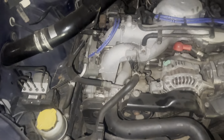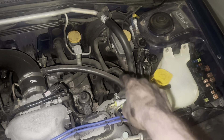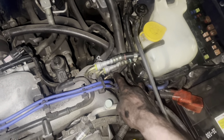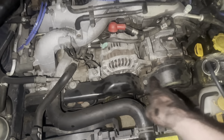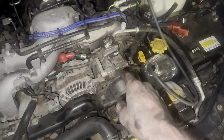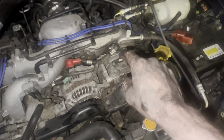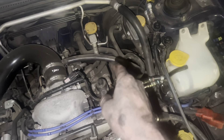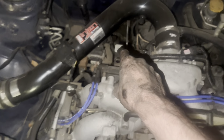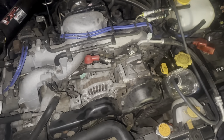I'm going to start pulling this one tonight. I'm going to pull the intake off right here, this line off to the brake booster, and fuel lines right here. I'm going to pull these covers off, radiator out — same thing — power steering pump off, AC compressor. I'll test and see if there's AC in there; if there's not I'll take off the lines, if there is I'll take off the entire compressor. Battery, starter back there, two coolant lines, bell housing bolts, and then connectors and motor mounts — and this motor will be out as well.